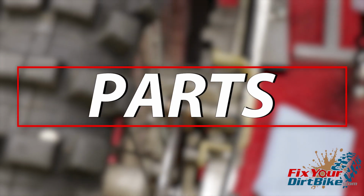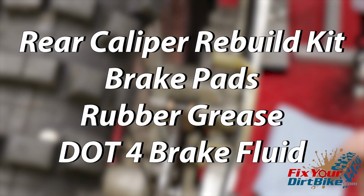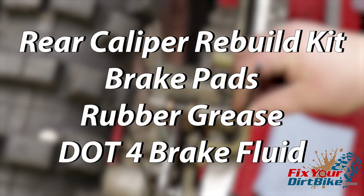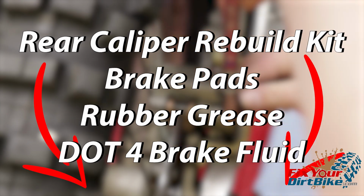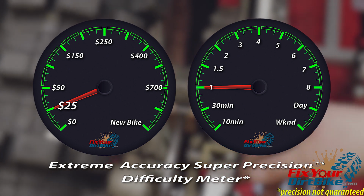The parts you will need are a rear caliper rebuild kit, new brake pads, rubber grease, and a fresh bottle of DOT 4 brake fluid. If you don't have your rebuild kit or brake pads yet, I put a link below for the ones I'm using here. This rebuild should cost no more than $25 and should take around an hour.